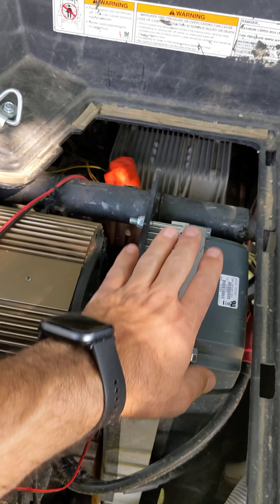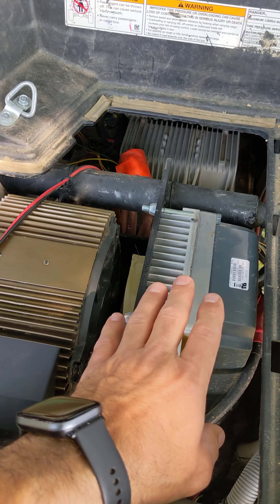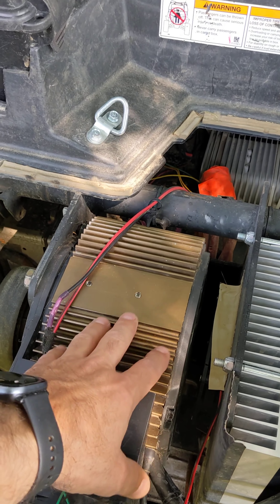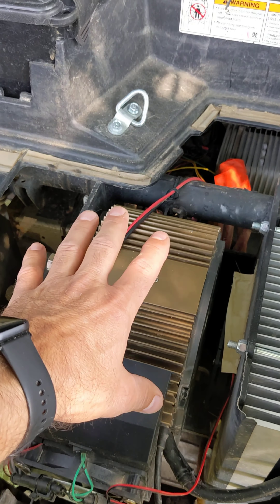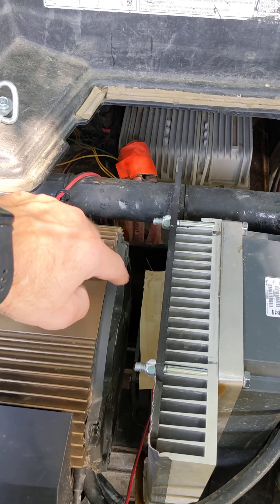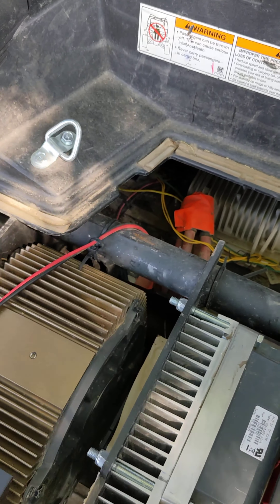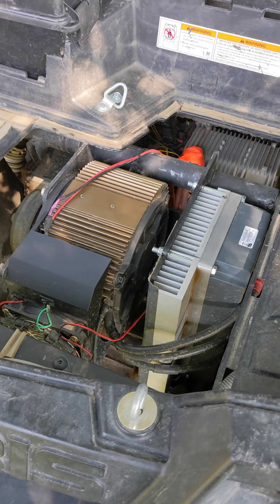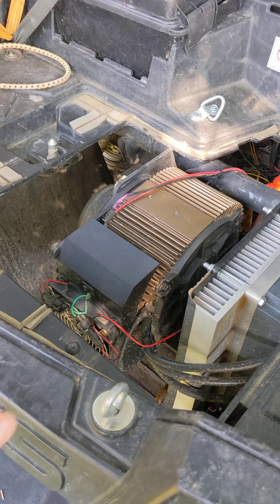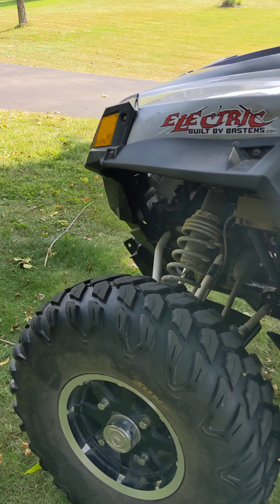Since the controller area is typically cooler, it operates between 30 and 60 degrees Celsius maximum. Even if that warm air blows on the motor, that's relatively cool, because the motor can go up to 100 to 120 degrees Celsius. So it's fine to blow warm air on the motor — it also helps push air into the stagnant pocket in the back. This solved all of our problems on heavy riding on trails. The only issue was out on sand dunes pushing the limits.